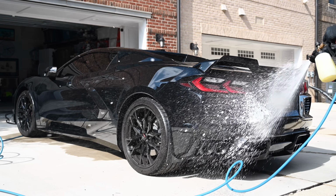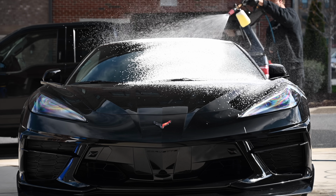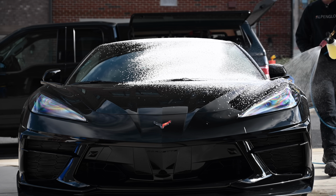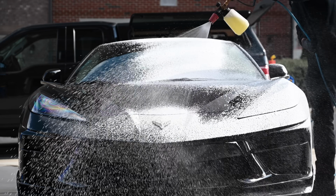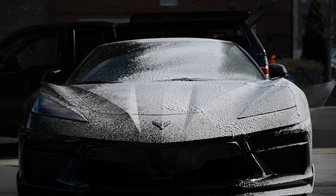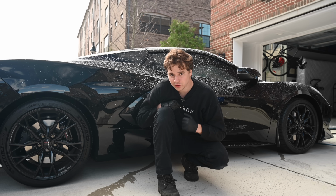First, we're going to blanket the car in foam to take off the top layer of dust and road grime on the car. You're going to want to use a pH neutral soap by default, but if your car is really bad, you might have to opt for a higher pH soap called an active soap. Now, I'm not affiliated with any brand, but I'll post my favorite of both categories in the description below.